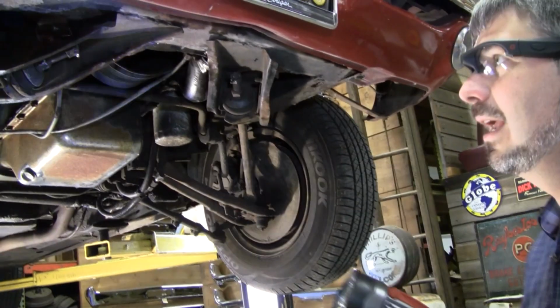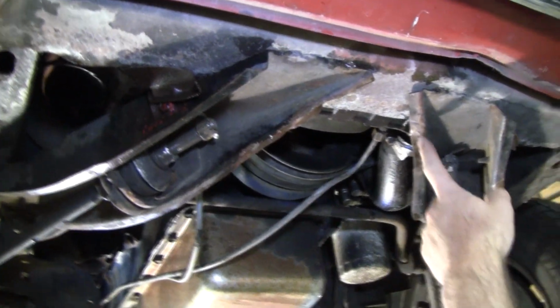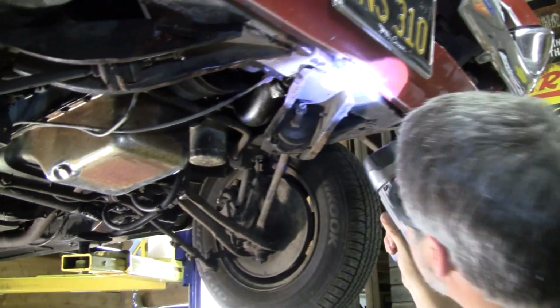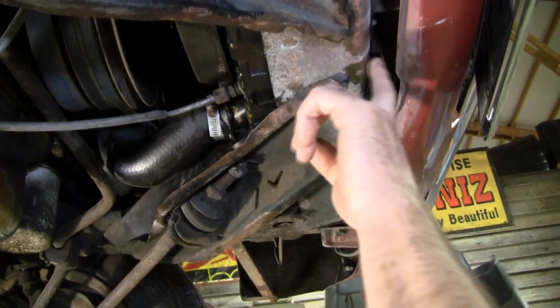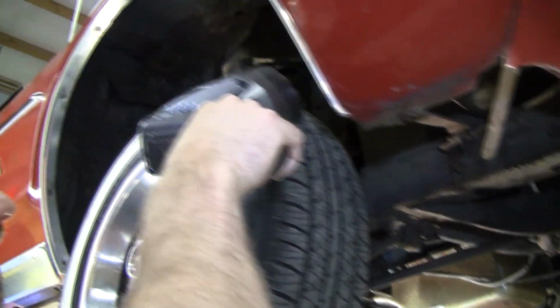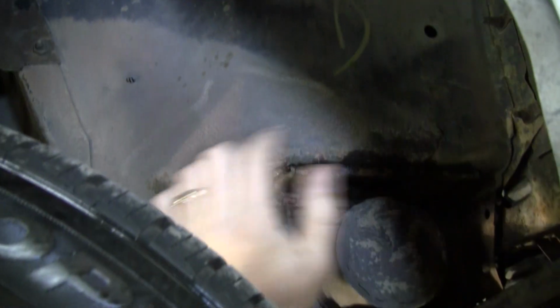Okay, starting at the forward portion here. A little damage is indicative of a floor jack. A lot of damage is indicative of the car being driven off of it. This car's been bottomed out here, but more important, you want to look at this piece here. That's nice, hasn't been T-boned, nice edge here, good contour, no rust. That passes. Okay, let's look over here. Aha, look what we see here. Rot. Again, don't assume that you're just going to patch this. You see a hole this big, you're going to be cutting out probably the whole section here.